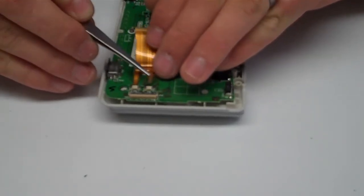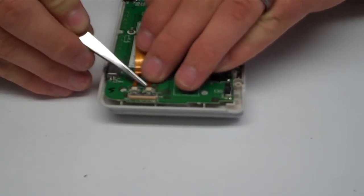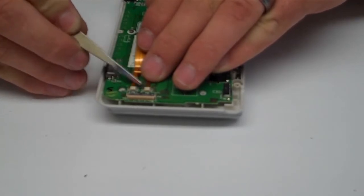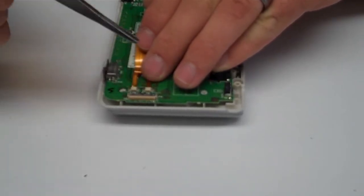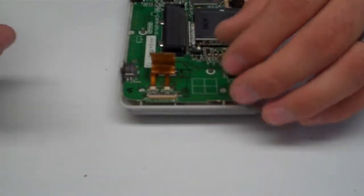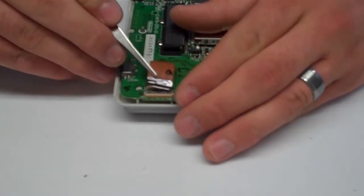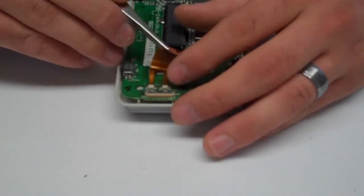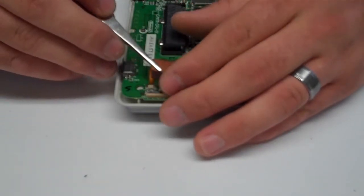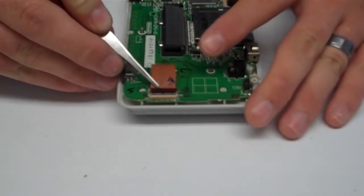And we'll do the touchscreen clip. Go ahead and slide that into place and push that back down. If you don't push these down, they might not make proper contact. And if it's your LCD, it won't work properly, and if it is your touchscreen clip, it won't work properly. It'll only have a very slight connection. And the same thing we did with the upper LCD ribbon.